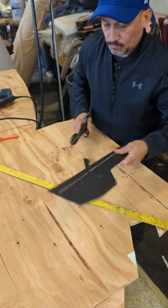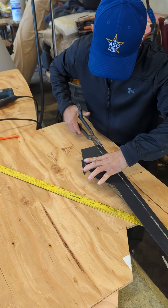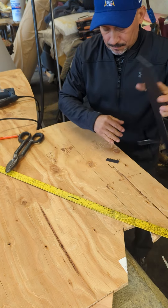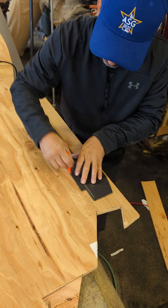Little by little I am getting the shape of that part right there. I will cut right here on the front. I don't want to raise a lot — I just want like a half inch, no more than three quarters of an inch on the front. So I'm using a sheet of cardboard to make the pattern. I take that to the table. I don't want that piece, the base, to raise more than three quarters of an inch on the front. Then I will transform this pattern into wood.